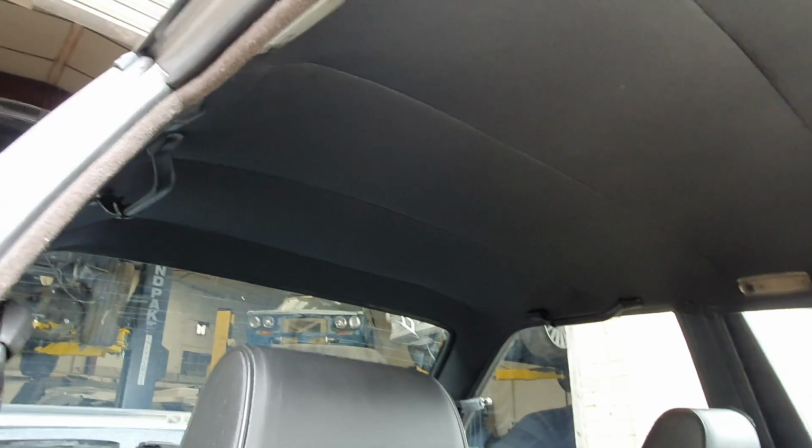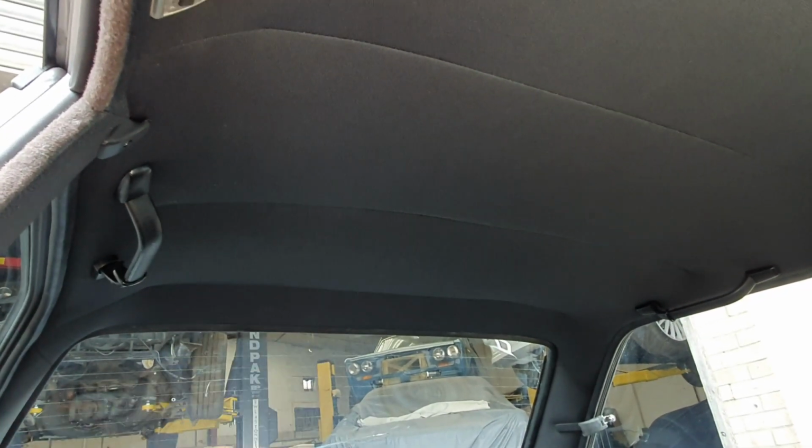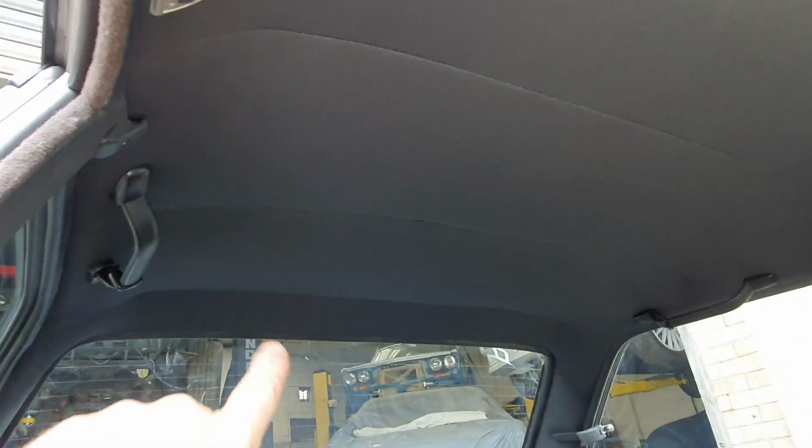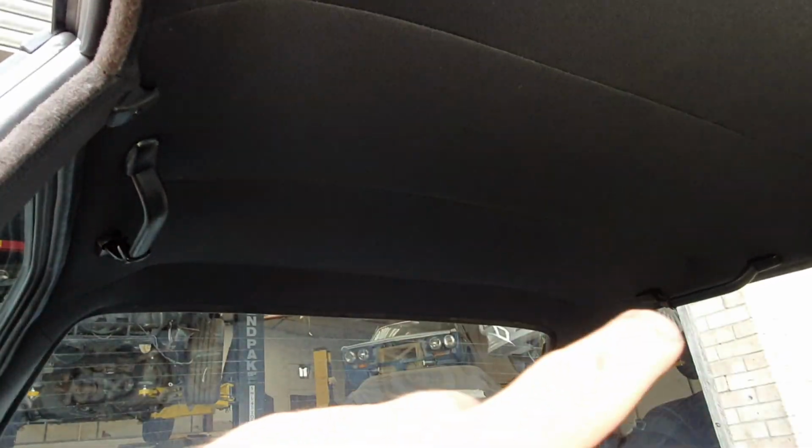customer. So again, this is another part that we can supply if you convert your car to a non-sunroof car. It's a black sport headlining, completely made from scratch, and it's made to work with the original bars. The only downside is that you need 4 of the rear bars out of an E30. So you can use 4 of the sunroof model rear bars only. You can't use the forward bar, or you can buy yourself, if you're lucky enough to find one, a non-sunroof headlining and use all the original non-sunroof bars. But basically, we used 4.